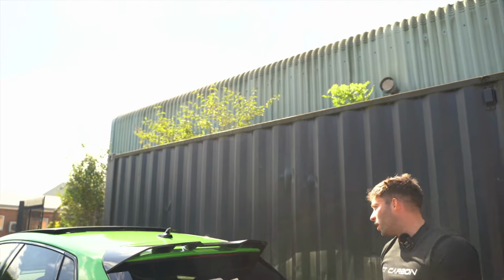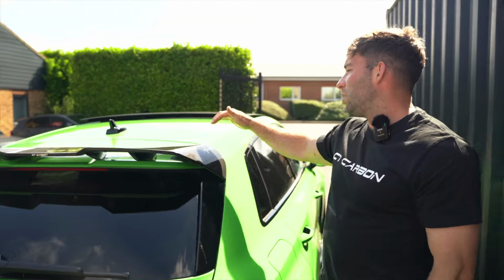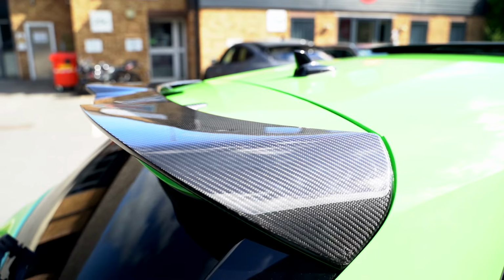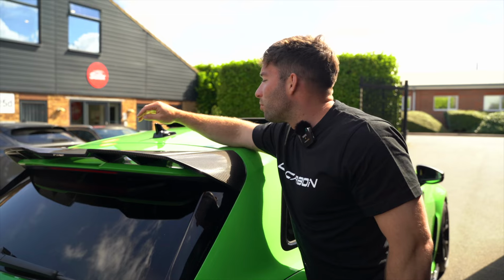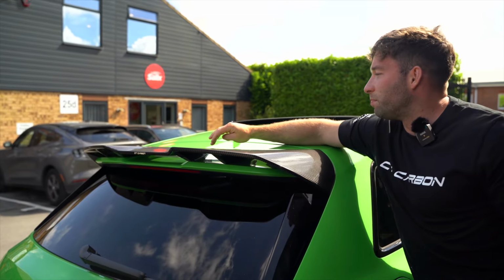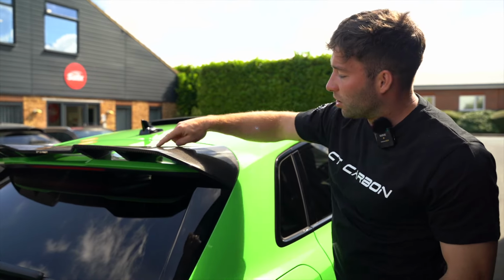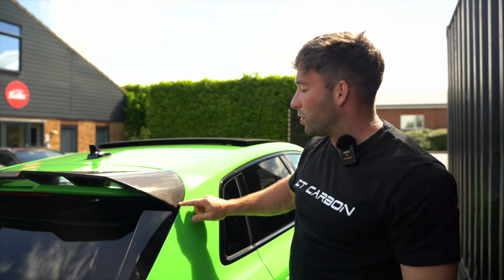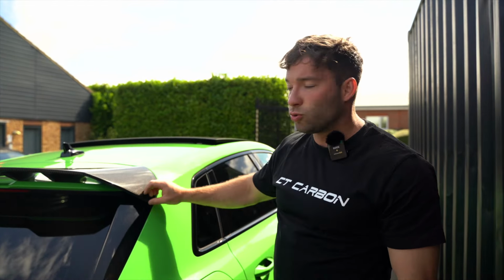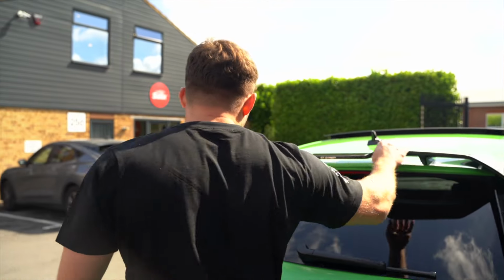And then with the spoiler, Ian PPF'd the green bit of the car, which I would recommend everyone to do really, because it protects the paint if you want to take it off. So it's double-sided taped in the middle, all these middle pieces here, and then the way the black bit here kind of goes up with the green part of the car, the actual paint of the car up here, we put double-sided tape here to stop the tiger seal dropping down, and then there's only a little drop of tiger seal each side just to make it extra secure.